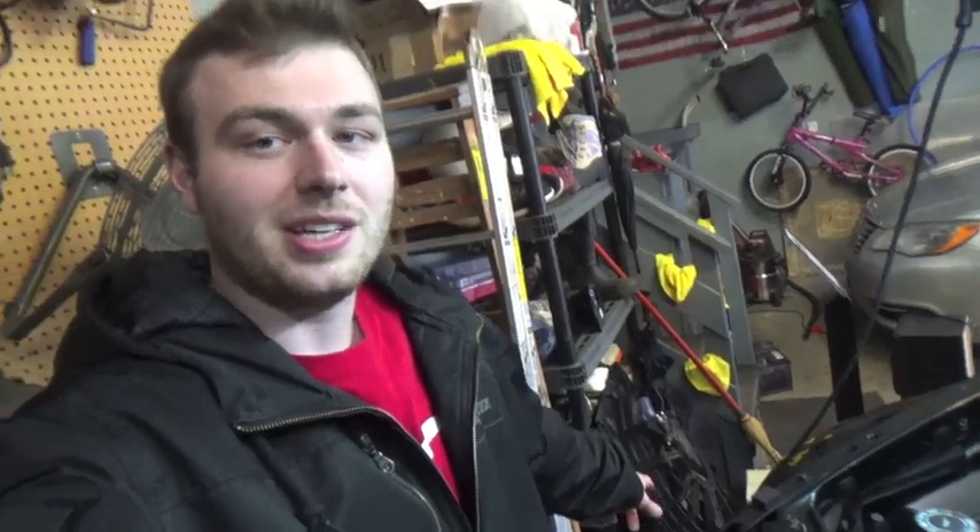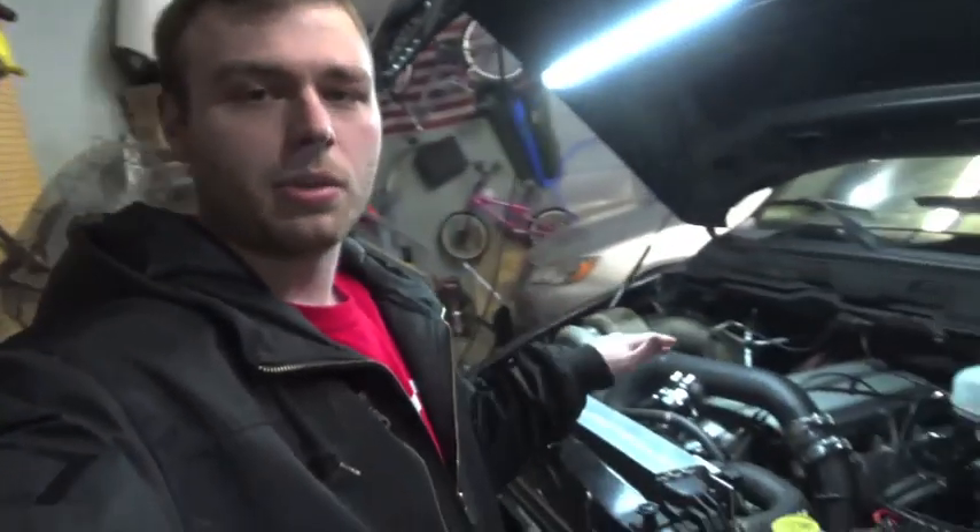The electric fan kit I built myself uses two 15-inch 3000 CFM fans. It does pull a lot of battery power, but I was having a problem with my hydraulic fan — it was shaking like crazy. You could literally watch the hood shake when it went on high. It didn't do the best job at the drag strip either; I had a 170-degree thermostat and the truck would still hit 200 degrees going full-blown down the drag strip.